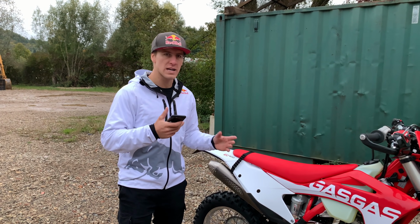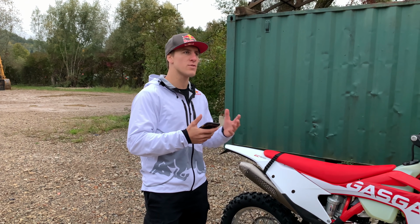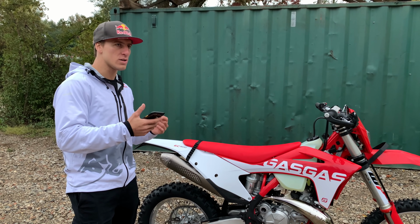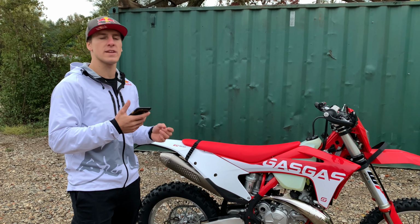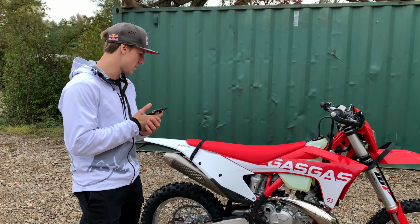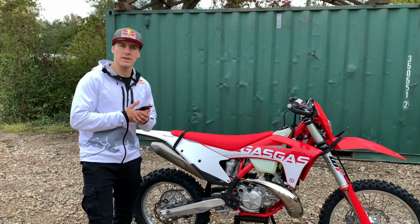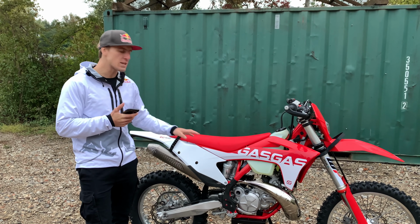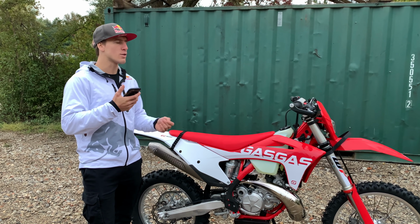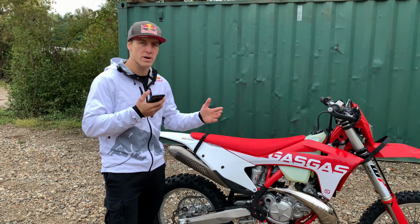But I really love the progressiveness of the system in the rear, because it gives you a good combination of fast riding stability, but also of progressiveness for the more technical stuff. So that's really nice to have. And if all hell comes loose and everything goes wrong and you overshoot or whatever, you have the hydro stop in the rear shock. So that's the hydraulic end stop, so it's not going metal on metal or full bottoming out.